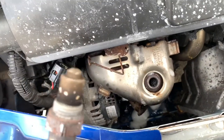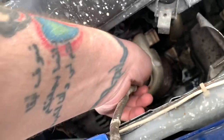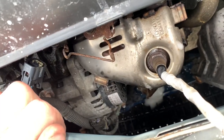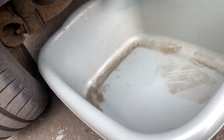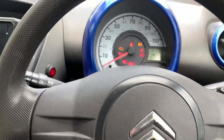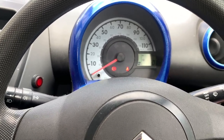Anyway let's have a look how it looks first. Right, well we can't really see that much of that because there's still bubbles in it. So I'm going to insert this sensor just finger tight. Right, and I'm going to plug it in and then I'm going to try starting it. Hopefully without causing catastrophic engine failure, but we'll find out soon. Right, so that's actually back up finger tight so I can take it back out in a minute. And I've also put a tub behind the exhaust just to catch what comes out. Like I say, if it starts - moment of truth. Right, if it just clicks then we've got issues.